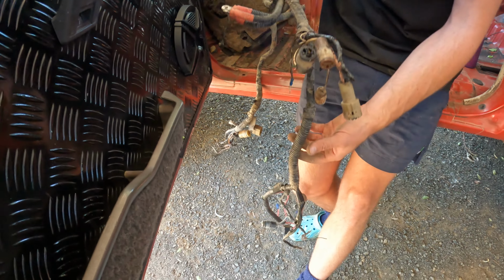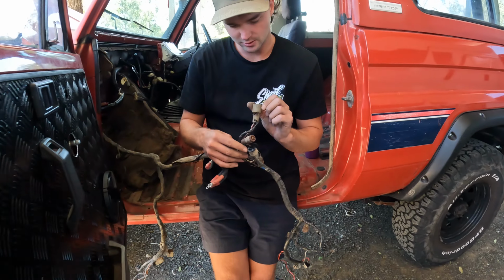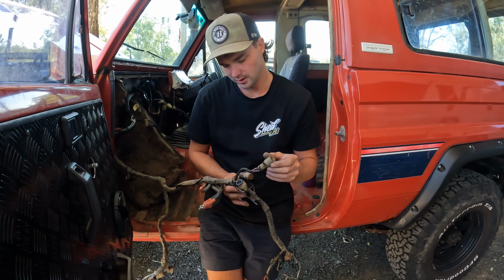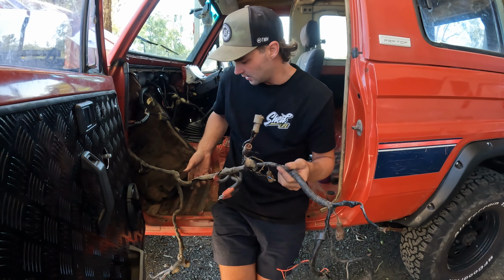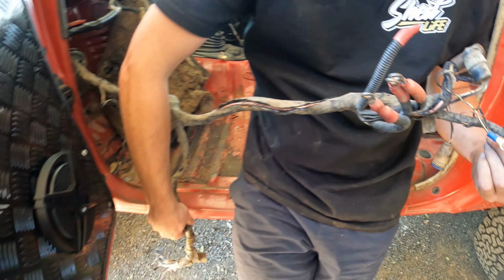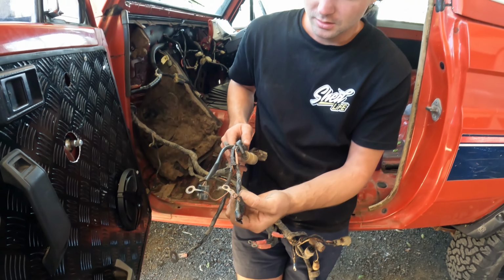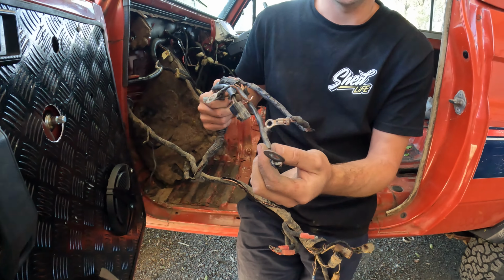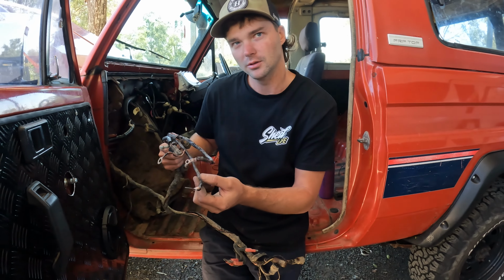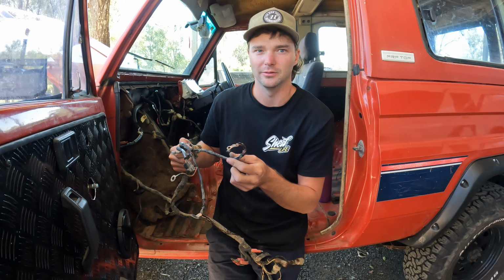What have we got here? We have got the aftermath. So, fun little fact. This baby right here that is all melted was the glow plug relay. Now the glow plug relay, they're the wires there that run through this whole harness. Well, used to. The copper's still there. All the way up here, as you can see, it was warm. Up to these ends, and it is what normally warms your glow plugs up and caught fire. Not the whole car normally, so yeah, we had obviously an upgraded version that did the whole vehicle.